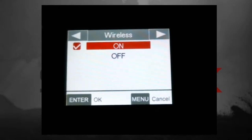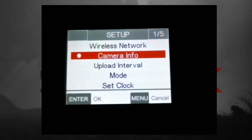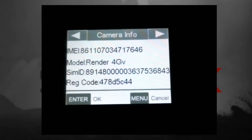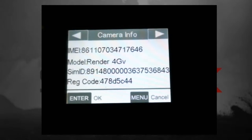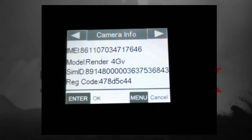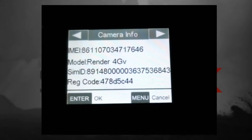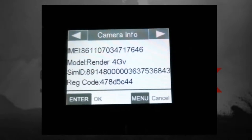Select the on choice and hit enter, then go down to camera info and hit enter. This is going to be all of your camera info that you'll need to register your camera. If you opened up this menu option and all the labels were there but none of the actual data was there — it was all blank — just hit the menu button to back out, give the camera a minute or two, and hit enter again. Sometimes it can take a minute or two to initialize all these values.